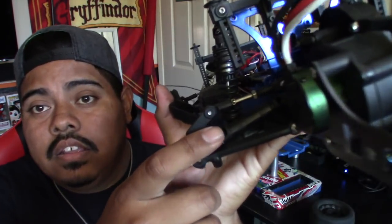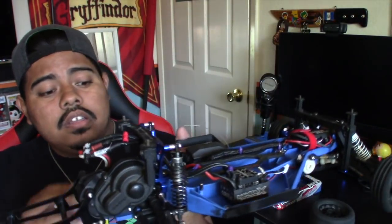As far as mounting the body, I'm running the ProLine screw top mounts. For axles, I'm running plastic stock slash axles but cut down. The reason is this is an RC car - it's going to break. Do I want the weak point to be the transmission, or a cheap axle I have tons of laying around? It takes about five minutes to cut it to the right length. I'd much rather that be my weak point than something bigger that takes me out of race day. I've gotten 50 races out of this and haven't messed it up once.